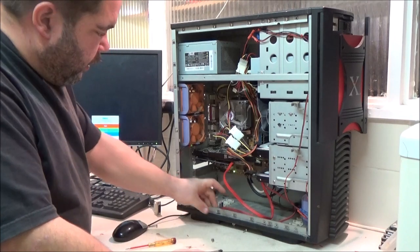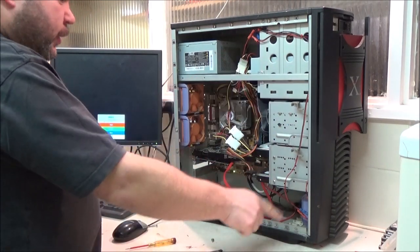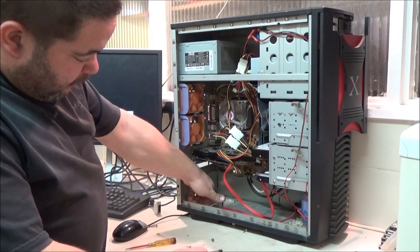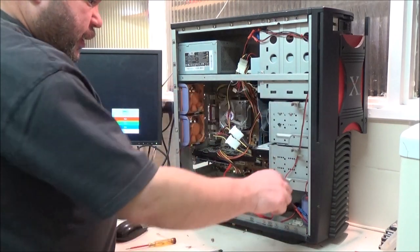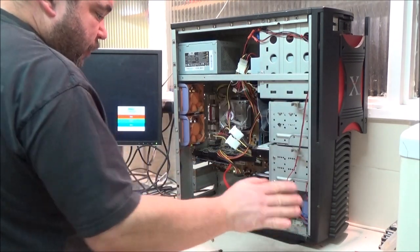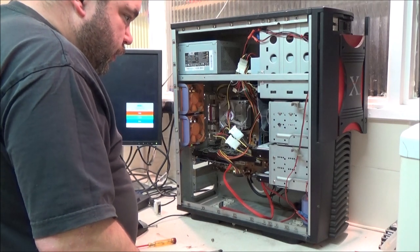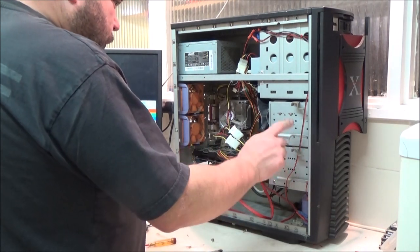Now worry about cable management. I have tidied my fan cables up because they were a mess. I don't know if you remember from the last video, there was a big white cable going down there and the fan cables were flailing all over the place, but I've added an extension in for these two, which now runs down here under the lip at the bottom of the case to the front two fans where I've joined them up and just ran a nice matching wire, red and black wire, up the top here. That does flap around a bit, but there is nothing to cable tie it to. I don't want to cable tie to this because these bays remove, that's the locking latch for it, so I don't want to cable tie to that or that.